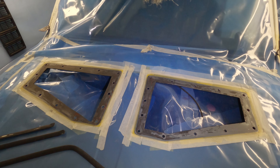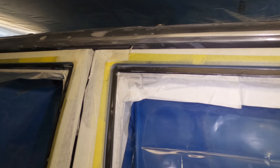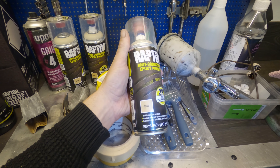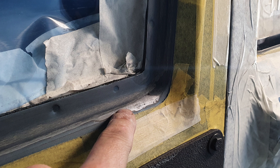We've obviously got existing OEM paint. In my case, I'm going to be spraying behind the trim of the windows — I did this job five years ago, it's black paint already existing there underneath the window trim. All I've done is taken that down with 240 grit. We'll be priming that with 2K primer. If you're spraying Raptor liner over existing Raptor liner, you don't need primer — just key down the Raptor liner. But if you're putting it over bare metal, I'd suggest a primer, because Raptor doesn't bond well at all to bare metal, even aggressively keyed bare metal.